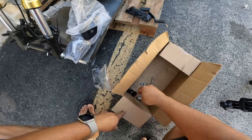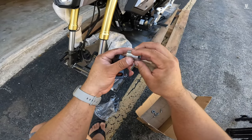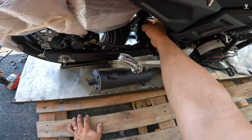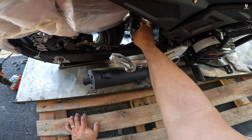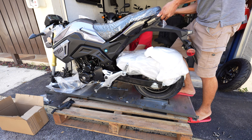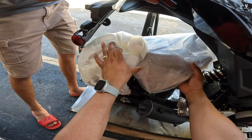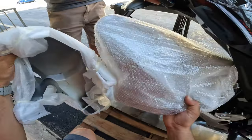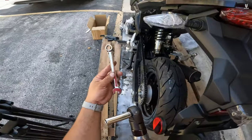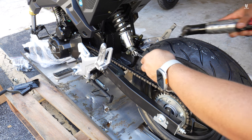Some of these brackets are for the front wheel. We get spare screws, some covers, and the mounts for the handlebar. We get the little spacer for the front wheel — this goes inside the bearing. In order to hook up the rear suspension you have to remove this screw, looks like a 14-millimeter, the bolt is on the other side. This is where it gets hooked up. With a size 14 wrench and a size 13 socket we are ready to tighten up this screw.